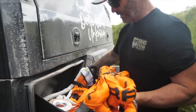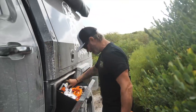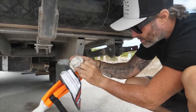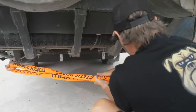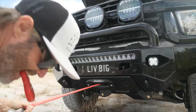For safety we've got fusion soft shackles, static ropes, and kinetic ropes. A three-meter static rope will do perfectly with a couple of soft shackles. The purpose is to create a bridle for a center straight pull to pull the van back evenly, so we'll pull them up here for a perfect center pull.